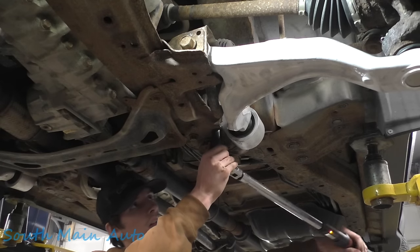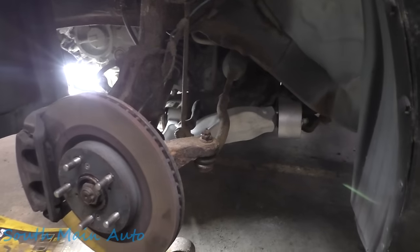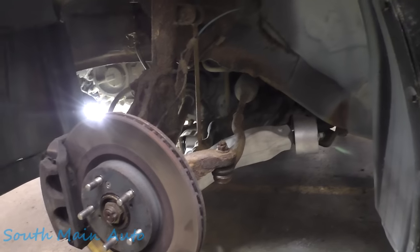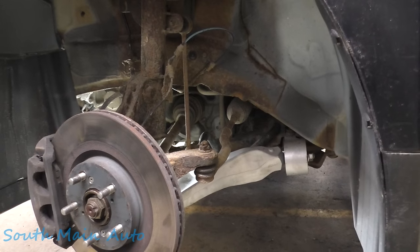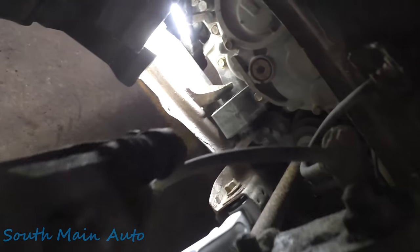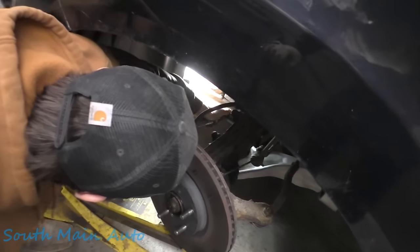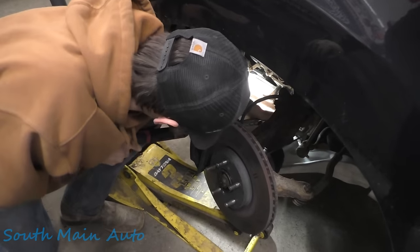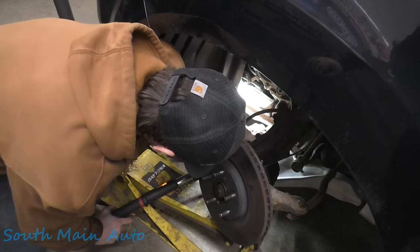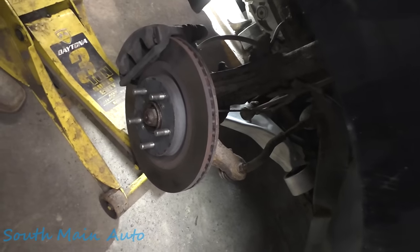Those two are fixed. The bushing swivels back here — they're not 119, they're 69. When we set it down we'll tighten the bushing back here and the front one — both of those are 119 foot-pounds. Once we get that torqued, let it down with the floor jack, get it to ride height and jam them down. It looks good. We'll jack this up until the vehicle hits ride height — that'll usually start picking it off the lift. We're going to torque that front one to 119 and then do the same on the back nut. Making sure McCoy uses the torque wrench — making a YouTube video, you gotta keep it right for the people. We've already torqued that rear one to factory spec.